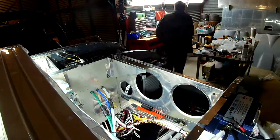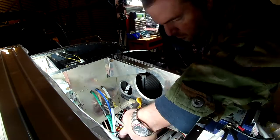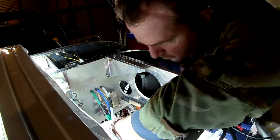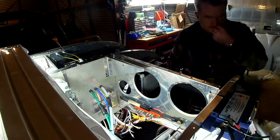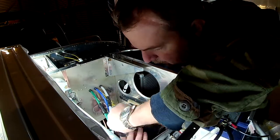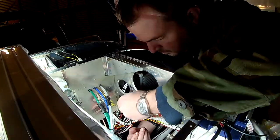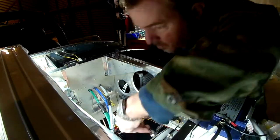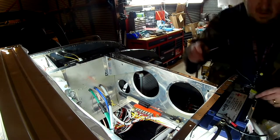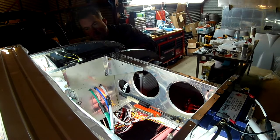I lost the footage, but I've gone ahead and put a terminal block here — you can see the little red one. It seemed a shame because we had a terminal block for the main bus just as a way to distribute to different rows of breakers, and I thought we needed one for the essential bus as well. This one will branch off to a few small essential things like warning lights, which I'm sure will expand in the future. Now, I know you're looking at it thinking the rod for the canopy is sitting on it — don't worry, its default position misses it by about 15 degrees even in its extended position, so we're happy with that.